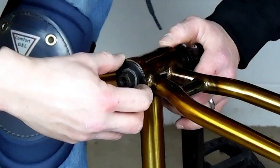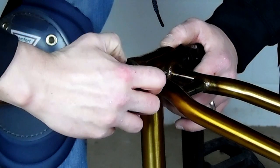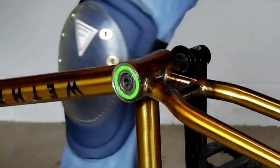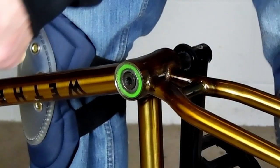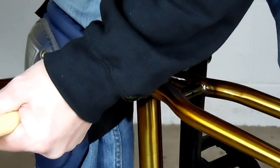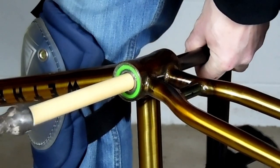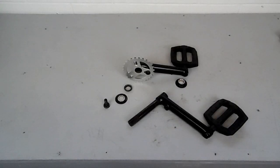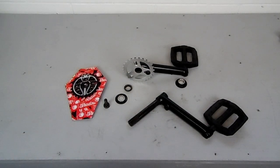After you get the arm off, we're going to take off our spacers and cone spacers. Then with a block of wood and a hammer, I usually hit the spindle flush with my bearing, and then use some sort of dowel to punch it the rest of the way through. I cut a section of broomstick out and it fits really good inside this 19mm bearing. After you remove the crank, try to keep all of the spacers and cone spacers for the drive side in one pile separate from the non-drive side — it'll make everything a lot easier in the long run.